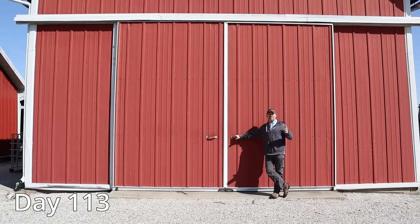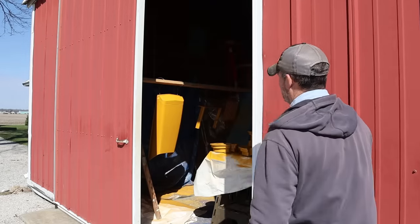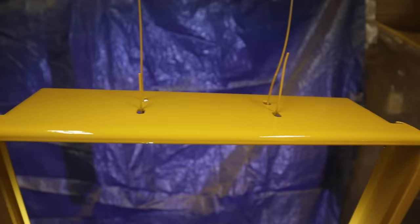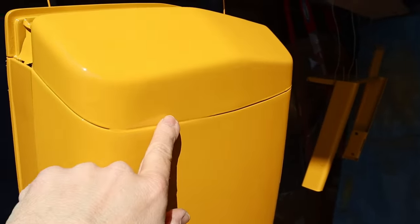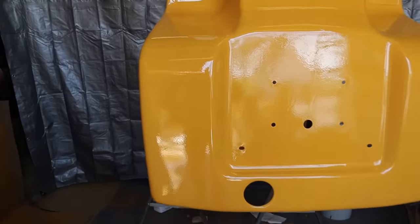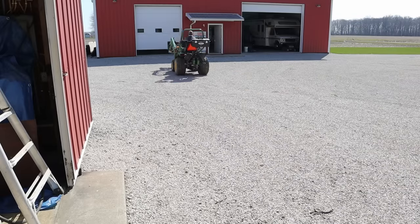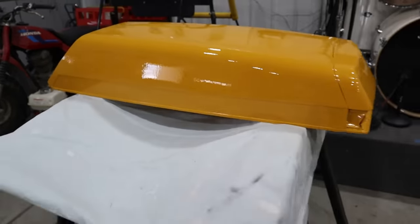It's day 113 and it's time to see what they look like in the sunlight. Without further ado — definitely shiny but the texture is not good. This run filled in that crack, so what do you do about that? See how bad that orange peel is? That's really bad. Depending on what I do — whether I reshoot them or try to wet sand some of the orange peel out — I'm going to have to get everything moved over to the shop and work on it there.